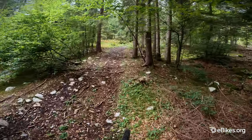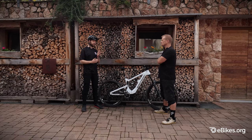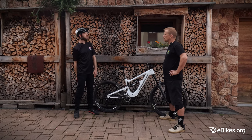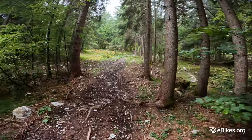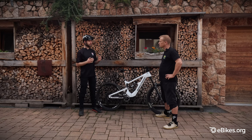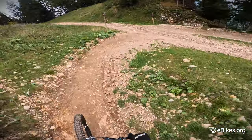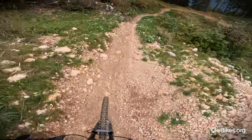With a powerful e-bike, you don't necessarily need to be in the absolutely perfect gear, and your cadence can vary slightly. The system tries to understand from your pedaling — it doesn't just shift up because you raise your cadence. It's not perfect: there are instances where you wouldn't have shifted because you can see ahead, but the bike can't. It reacts to what you're doing in that moment, and your changing cadence makes it somewhat predictive. Early development versions shifted way more, but we found if it shifts less, it produces a much more consistent ride feel.